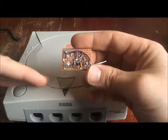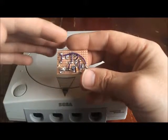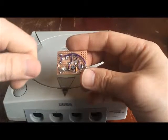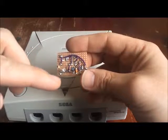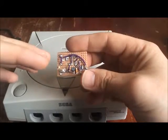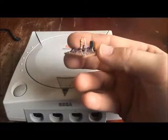I looked at it for a while because I think the instructions I got were in German. So I was like, what does this red mean? What does that wire mean? Basically the red dots mean that you cut the trace out, because you've got these traces running straight across — you just chop into it and break the trace. So that's the breadboard part.